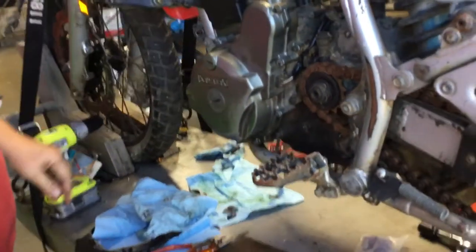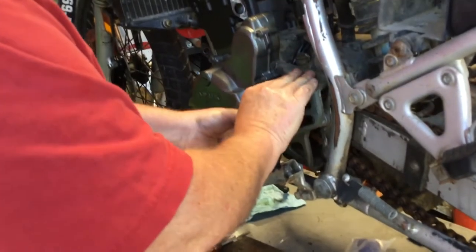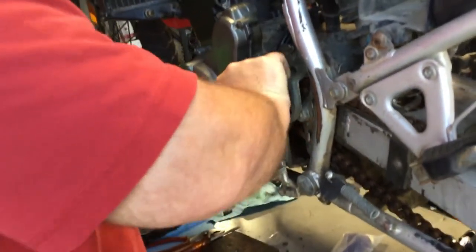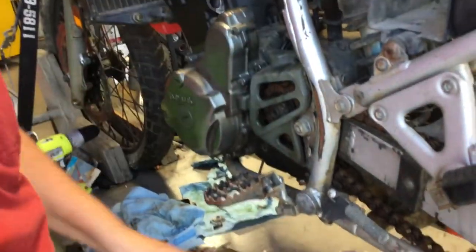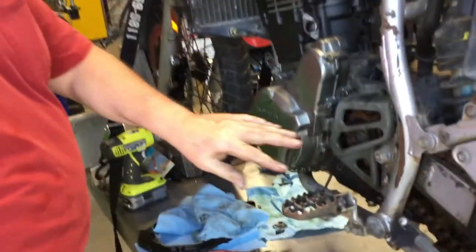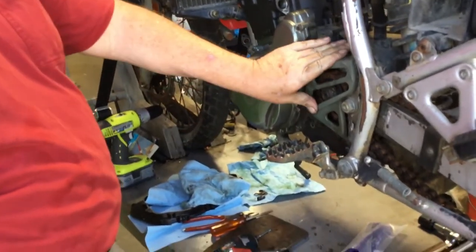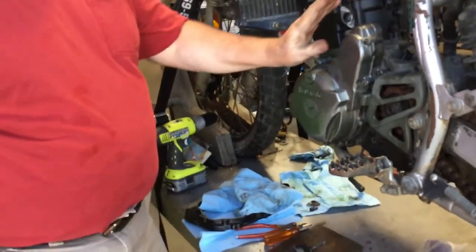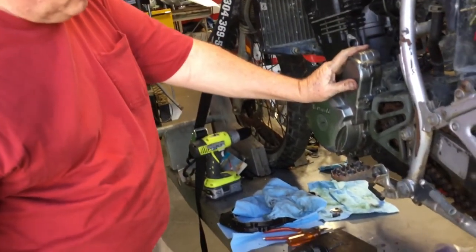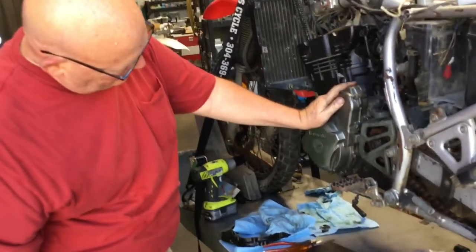And so that would be the next thing I would do, is put our countershaft cover on there. Put these three bolts in there. And they get the same torque as these. Sometimes people tighten them more, but it's only plastic, it's only a guard. That's fine. Don't forget to put oil in it. Oil's a whole different subject. You can figure that out.